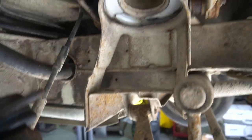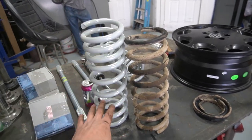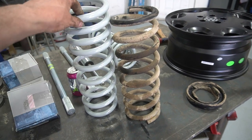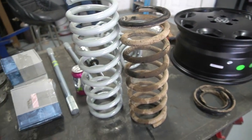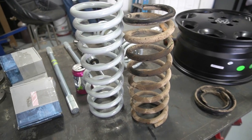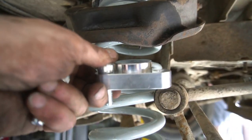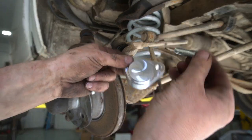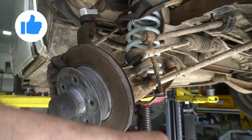Everything's loose — we're gonna have to really compress the next one. Sorry about the noise — this is how much height difference we got. Little beefier spring too — this is thicker, so this is gonna actually not compress as much when it's in the vehicle. We gotta compress the heck out of that thing — that should be fun. We can get it in there. Let's start compressing. We got that spring in there, spring compressor out. Now we're gonna put this spacer — this is the spacer that Go Westy gives you for this lift.